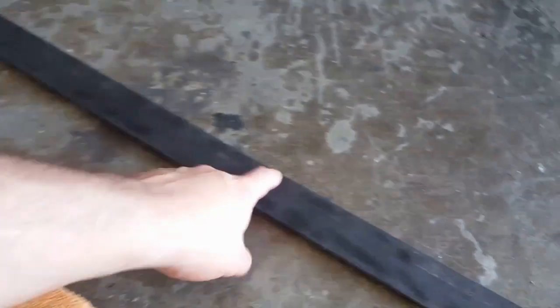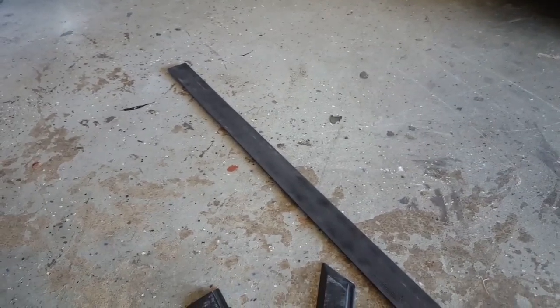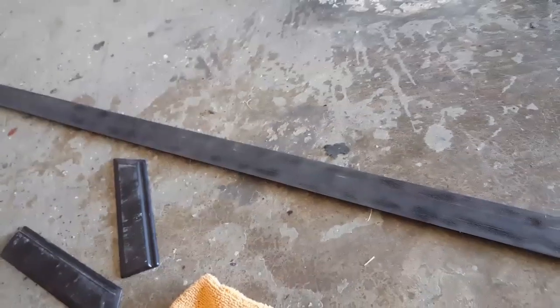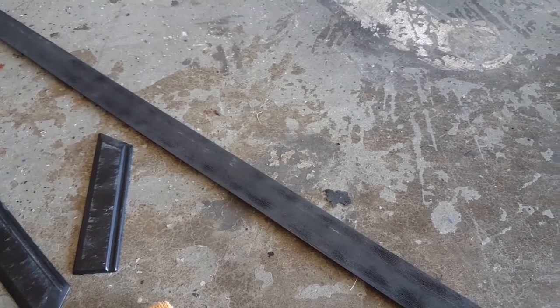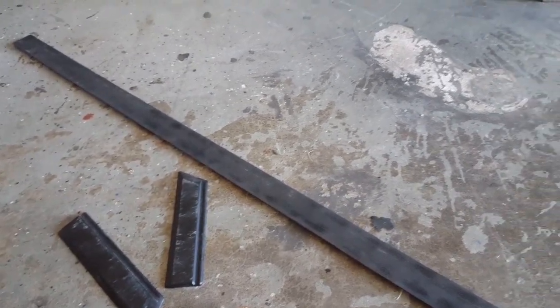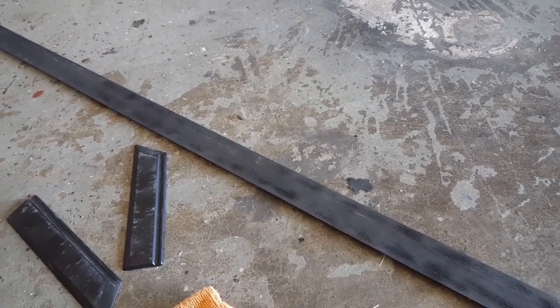Now on the back of these used moldings I had the old tape that was holding them onto the car, and you can't just peel it off — you've got to remove it in a certain way. I opted for mechanical removal as opposed to using a chemical. I started using sandpaper on a dual action sander, went to 80 grit and it came off pretty good. But I wasn't completely satisfied, so I ultimately went to a wire wheel on my drill — just $3 from Harbor Freight. That was able to get it down; you can see it leaves little bitty grooves in it.